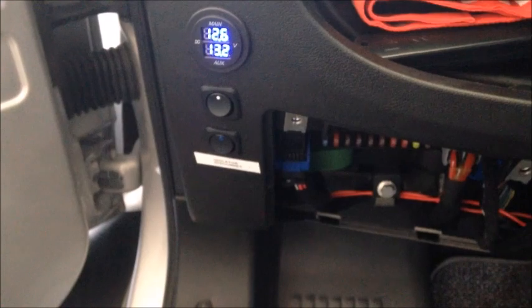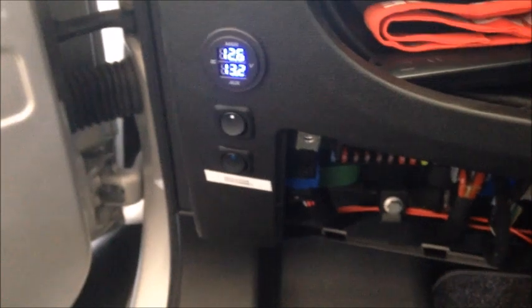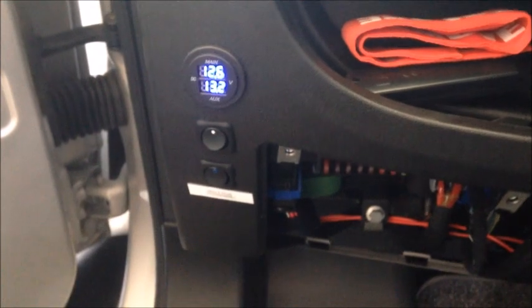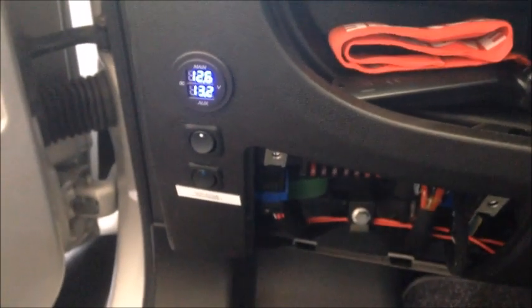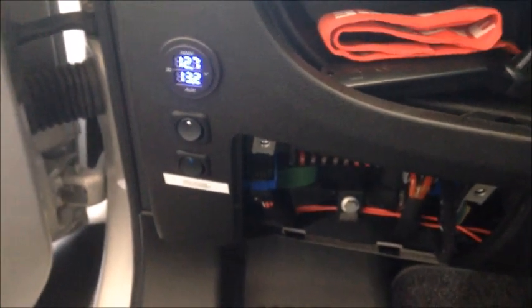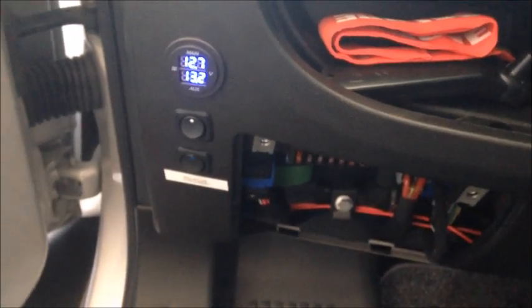One thing to be aware of if you're doing this on your motorhome is to contact BattleBorn, and I'd also contact Roadtrek to talk to them — although they didn't give me any encouragement about putting lithium in the Roadtrek and said stick with lead acid. If you have an underhood generator, make sure you really talk to everyone about that, because the underhood generator feeds back to the house batteries. BattleBorn batteries have a battery monitoring system — a switch in there that if the battery is overcharged or too cold, it won't allow charging. And if you stop charging a battery with an alternator, you could burn the diodes out in the alternator.